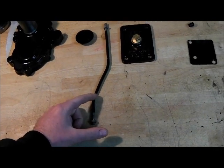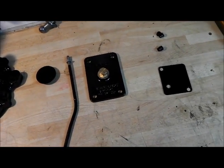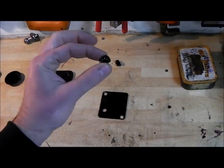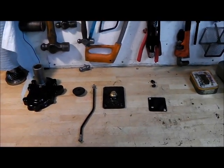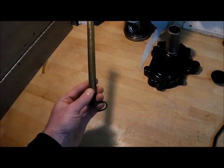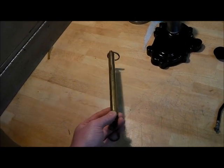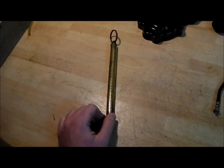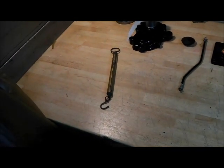Operating rod for the four wheel drive in high range - that's the yellow knob. And cover for the transfer box, that's a Roma drive one so I'll have to mark it with filler. Another gearbox cover plate - these are supposed to have these horrible little plastic breather cap things, I might make some brass ones, a bit like axle breathers, which will be a bit nicer. I've also bought an old spring balance on eBay - this is an eight pound spring balance - and from memory the output shaft gets a preload of two to four pounds, so right in the middle of the scale, which is where you want. I'll hang some weights on that of a known value to check it reads about right.